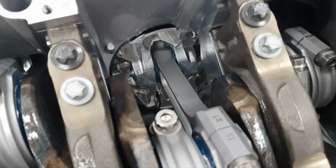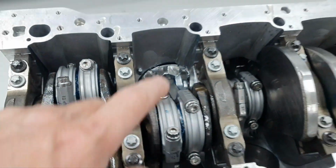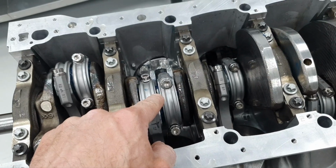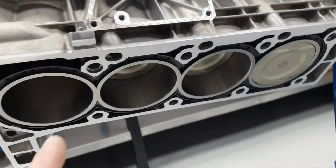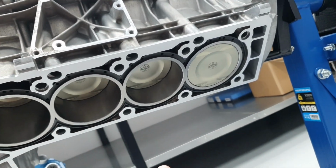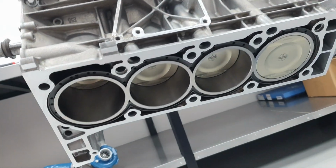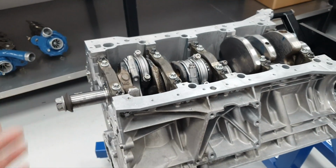All right, from down here, there's a cooling jet down over there, okay? So, I need to check the clearance for the cooling jets. Then I'm going to stretch the bolts, all right? And then I'm going to make sure, like any other time, that each piston is reaching top dead center equally. That means it's not coming one more out or more down, like the previous M157s. Exactly the same setup. I haven't changed the setup.